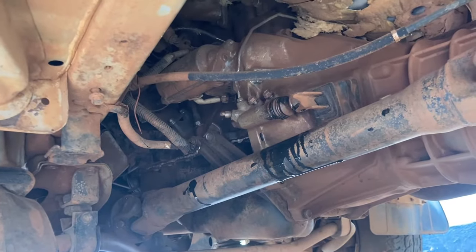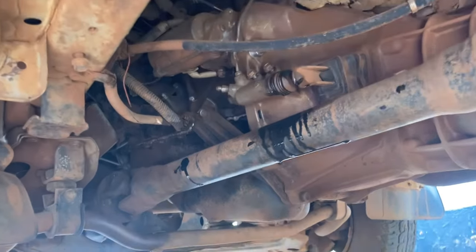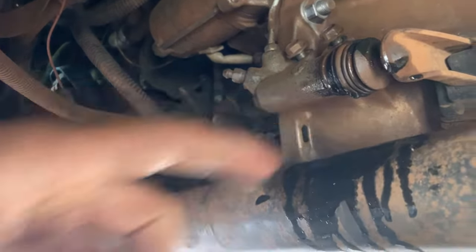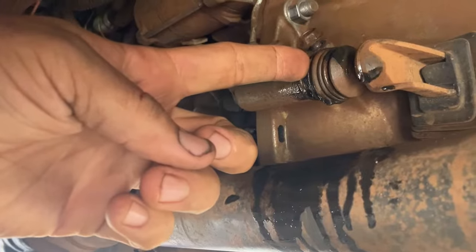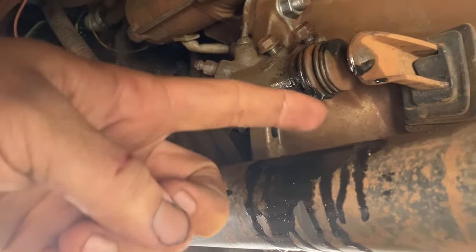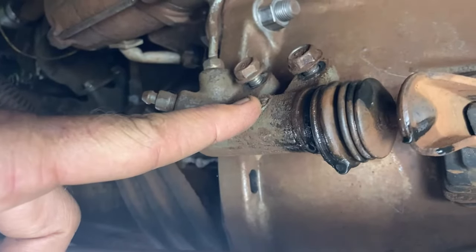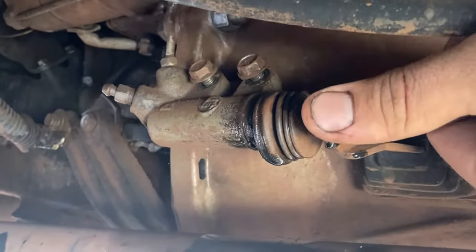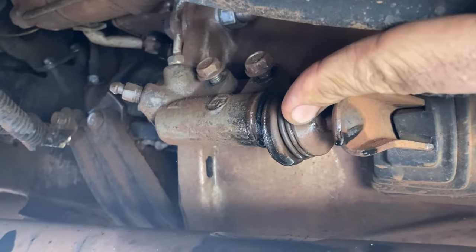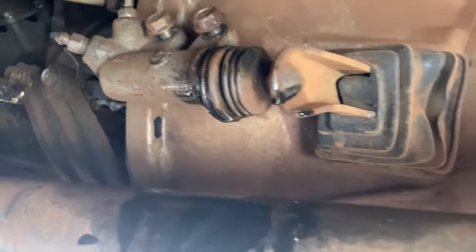You can probably tell why this was easy to find when I stuck my head under here to see if it was leaking. The driveshaft had a trickle on it — one trickle. I literally moved the rubber boot like this and it all came squirting out all over here. So what that definitely tells us is that inside this one, you have a bad seal. You're never going to get pressure on your clutch because this internally is going to leak off any pressure that would help push this piston, which would then push on your clutch release fork.